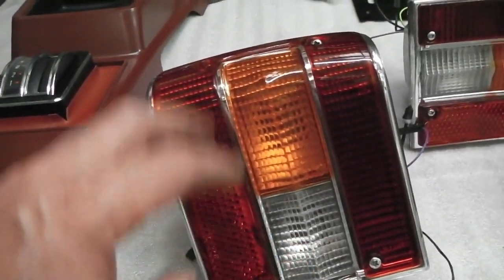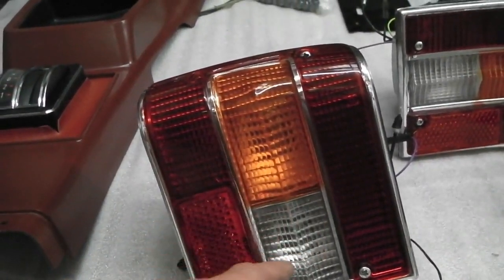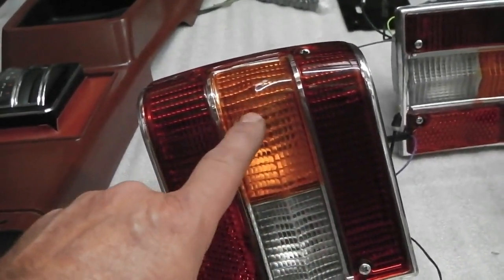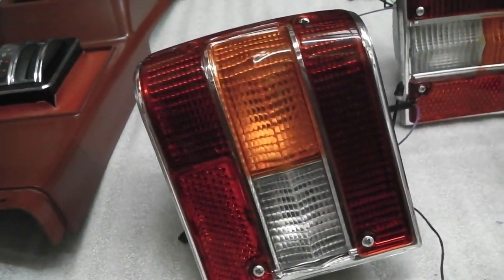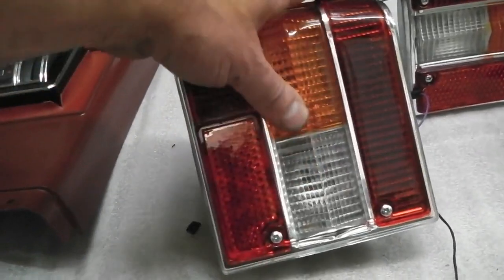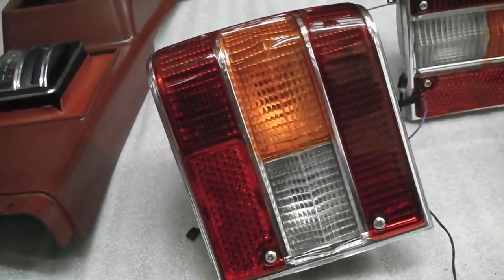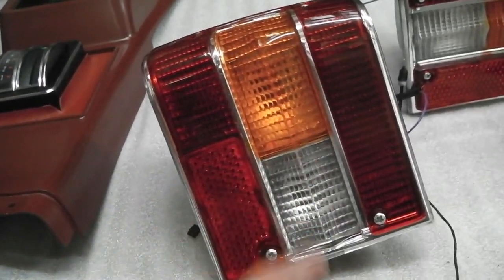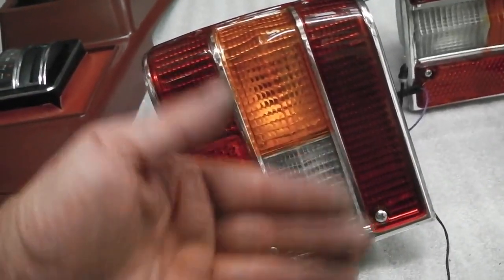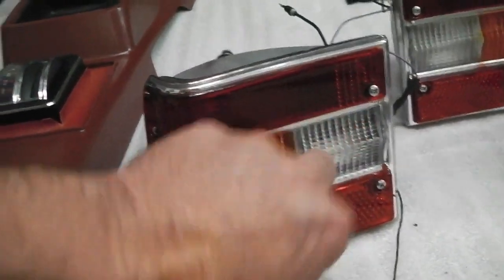Clean the reflectors up. Some Ford rear tail lights, they did away with the focusing parabolic mirror inside and, certainly for the reverse and the indicator, just ended up spraying them silver. And I thought that someone had refurbed some lights that I had and sprayed them silver, but every other Cortina I've looked at, apart from one, and I mean my cars and the scrap parts that I've got, have been painted silver. And the very early ones had parabolic mirror reflectors, basically tin glued into the unit. So I had an uneven pair. I had one that was painted silver, and one that had the reflectors.